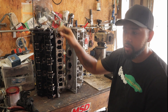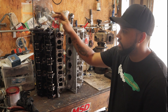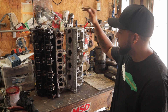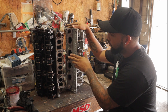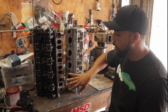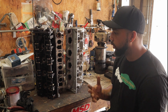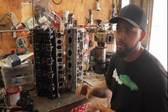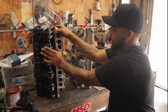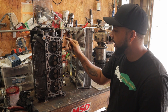The only motors that got a different cam were the 2003 and '04 Cobra, and the Cobras with the B head also got a different intake cam. So Cobras and every other 4-valve motor all share the same exhaust cam — they just have a different intake cam. This split-port design is definitely inferior to the C head. One of those ports is a circular port with flaps — the intake manifold runners — that stay closed under low throttle, which helps with gas mileage, then open up above around 30% throttle to give you full power.